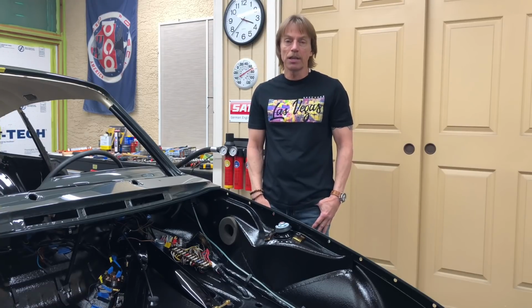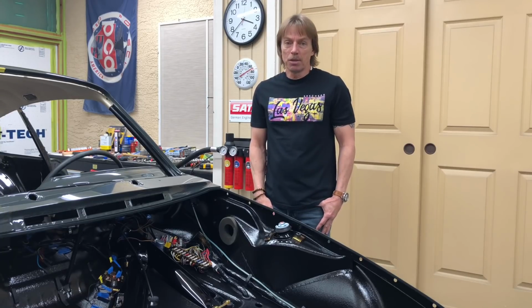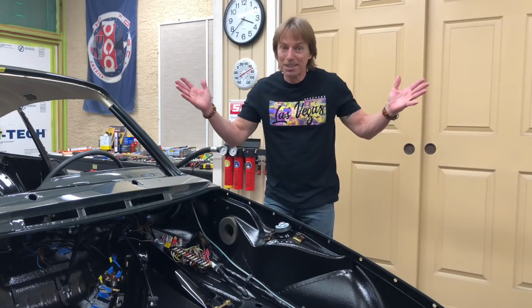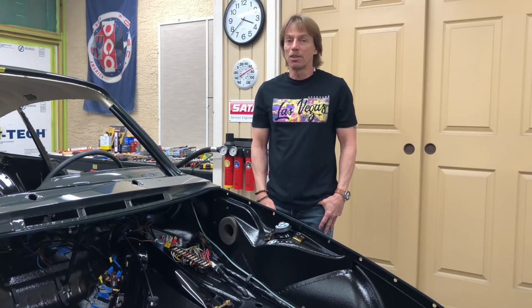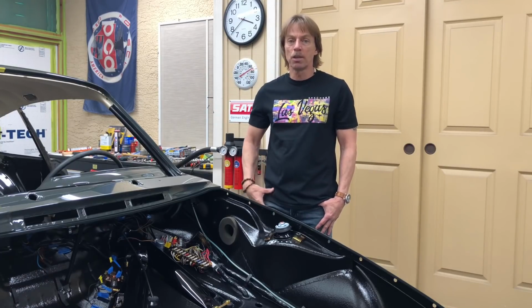So the only other thing you can do to help smooth this system out and make it work a little bit better, which I didn't show you, if you go back to one of the earlier clips, you'll see the cable laying on the bench had a little bit of a sharp end to it, a little bit of a kink in the line there. That shouldn't be in there. How that got in there, I have no idea. Maybe it could have happened when they were installing the system at the factory. It could have been through some servicing at some point. Maybe I put it in there when I took the system apart 3 years ago. I don't remember, but it wasn't that difficult to take apart. However, that shouldn't be in there. That cable needs to have just a nice, smooth, gradual slope to it for your best performance.